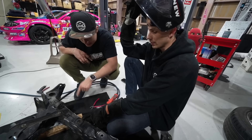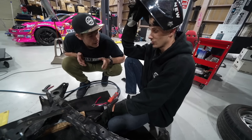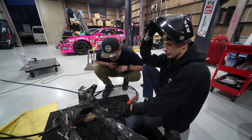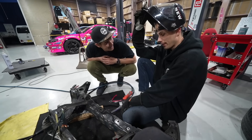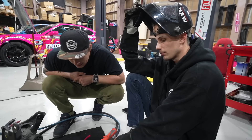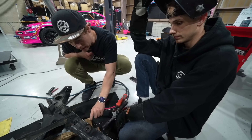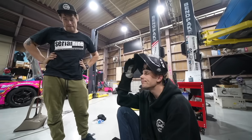It's wild. The fact that we found it like that is really lucky — and that's with stock bushings and everything. And this has not been drifted. I mean, it had an open diff, or I guess a little viscous, but no angle, no nothing — bone stock car. So just wear and tear, normal driving around will crack these subframes on JZX100s. It's not unheard of. So how long do you think I would have had? That would have most likely gotten pretty bad by the end of the weekend — especially if you've gotten a hit or something. And you've also got a better clutch now, no dual-mass flywheel, and with the solid mounts there's going to be a lot. So that's why we're doing the gussets — we're going to sand that, weld it down, and grind it flush because obviously this is where the diff goes.